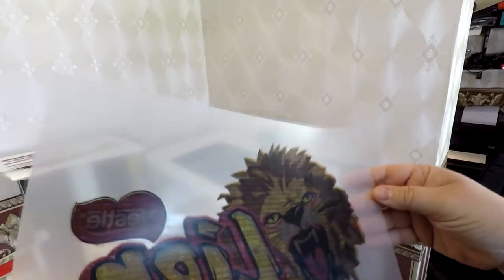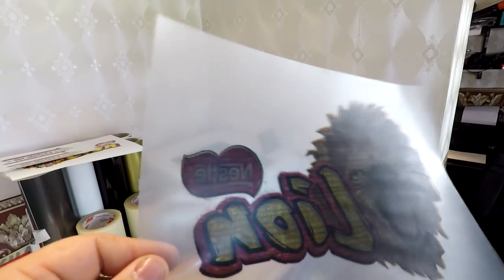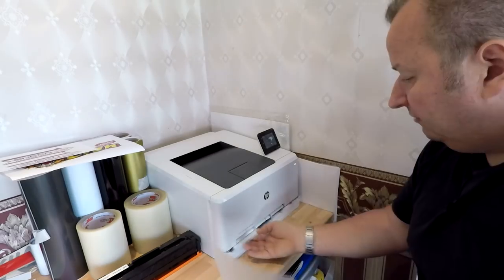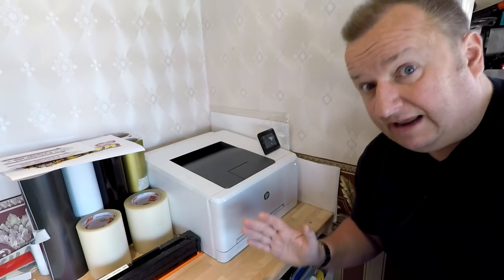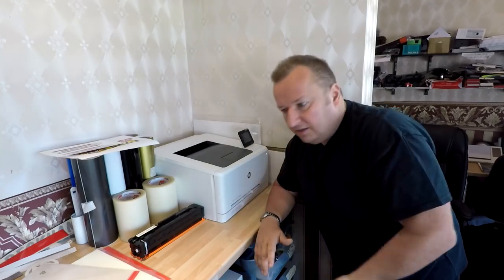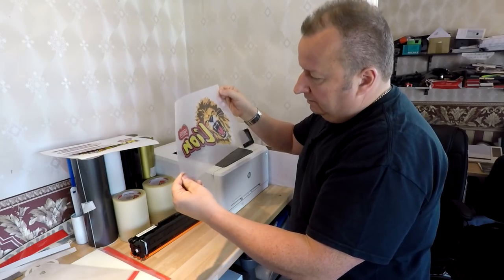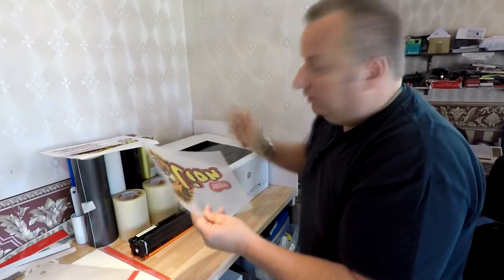I'm going to run another one through now with the white toner in as I should do, but I'm glad it showed that because it's revealed some sort of problem. They did mention it could be an issue with static, so I'll try to de-static this. Let's try again — face up, everything as it should be, just going to print it out again. I could have cut all this out but I'm leaving it in because this is the kind of thing you could come up against — call it teething problems. These papers are quite dear, so making mistakes is costly.